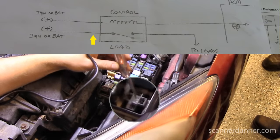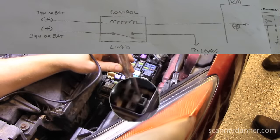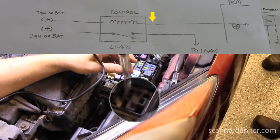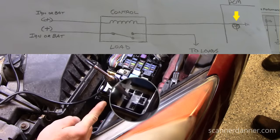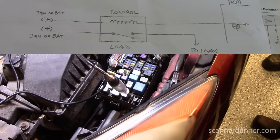This is the load feed — this would be the switched load that's going to feed these fuses. And then this side is control power, and this is the controlled ground. What controls the ground on this is the engine computer — it's a switched ground. And again, it's all about knowing your circuit design.